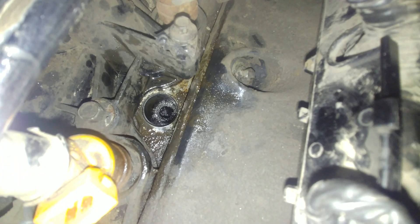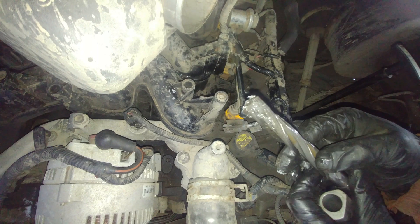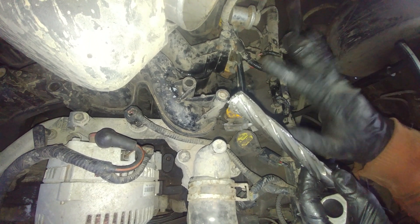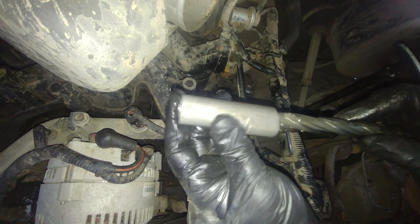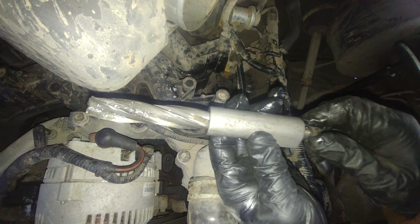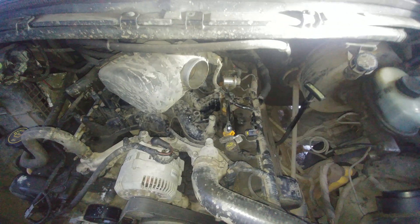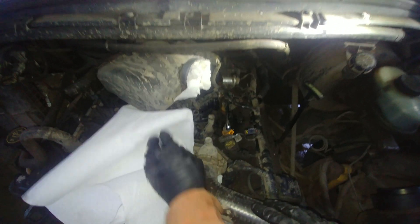You see those shavings around — the main thing is to get rid of those shavings 100%. It's been a few months since I fixed the truck and it runs fantastic, no problems, just like new. The guide allows you to drill straight, and the pin at the end of the reamer stops at the right depth. Always use safety goggles.